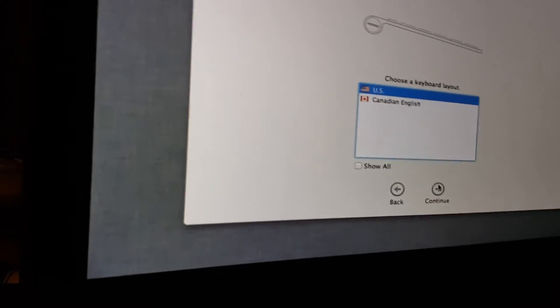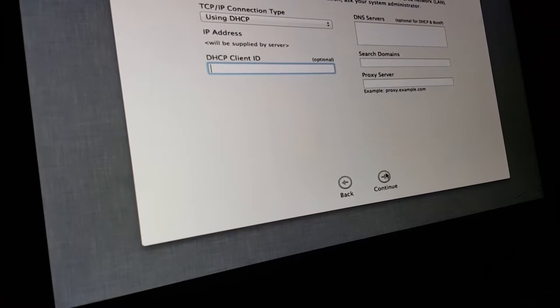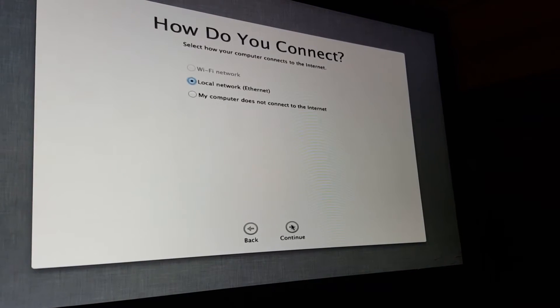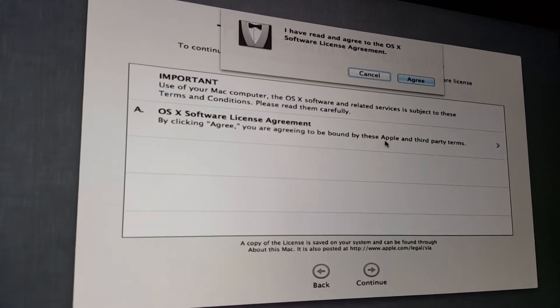Completely straightforward. No Wi-Fi, but I'm going to use an external Wi-Fi adapter which should be compatible with Mountain Lion easily since it's compatible with Snow Leopard. Going through the setup — selecting DHCP, continuing through the wizard. If there's no ethernet and no Wi-Fi, just say 'My computer does not connect to the internet' and hit Continue, Continue.